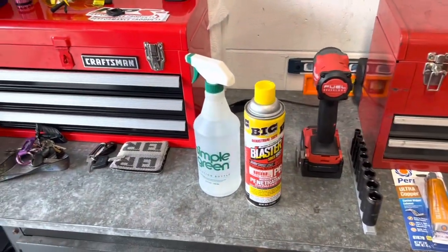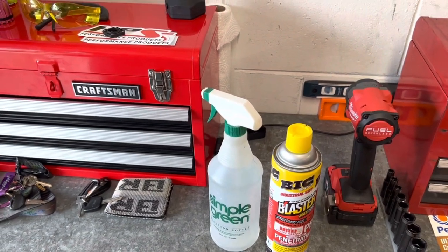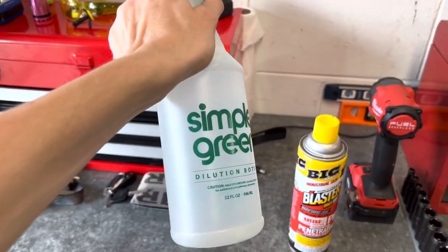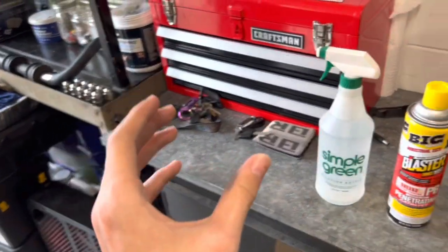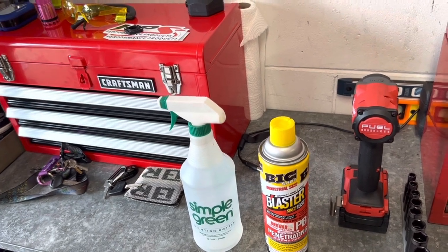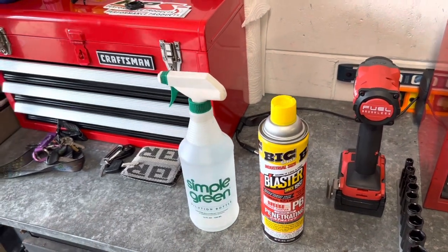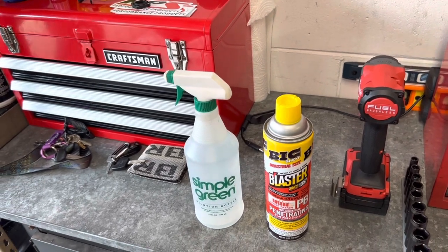And the trick that we talked about earlier is you get the car nice and hot, you drive it around, let the bolts warm up, let the exhaust warm up, and then you're gonna take some cold water in a spray bottle, and you're gonna spray all the bolts. And what that does is it causes the bolts to rapidly shrink, allowing it to break free of the rust, making sure you do less work without having to sit there and just grind away. Yeah, and you don't have to worry about stripping your bolts or breaking them. It's a nice, easy solution to help.